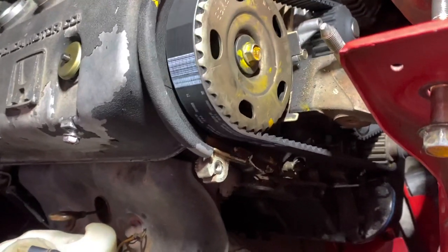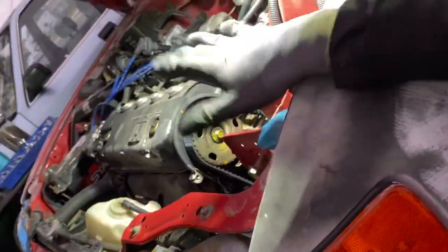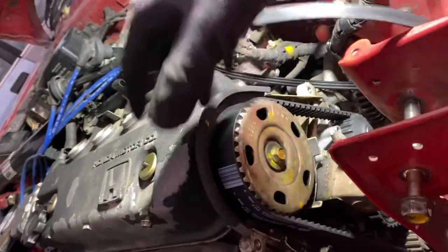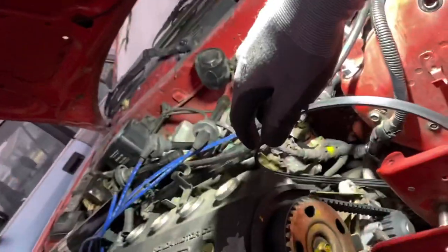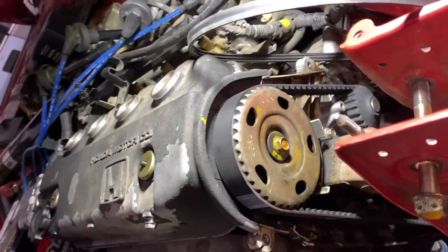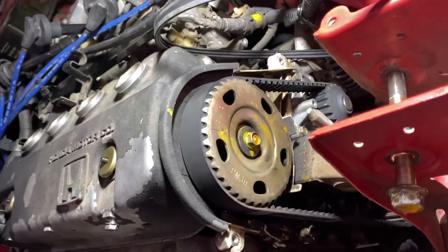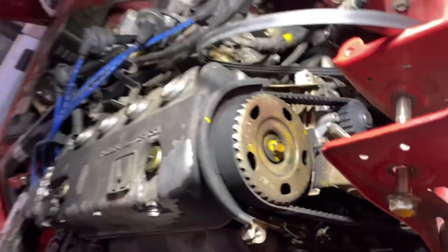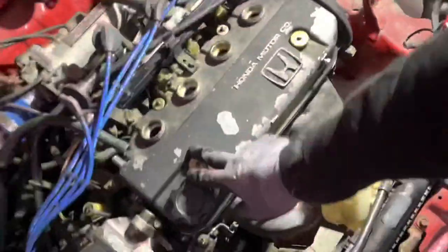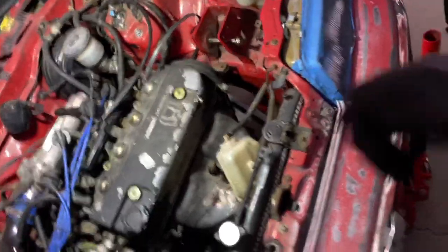She still feels good - I still feel compression. As long as you still feel compression you're good, and the engine's not hitting any metal on metal. It's very fluid in the way it moves, which means we're not getting any piston-to-valve slapping. You want to be really gentle with it when you crank it over the first time. I always recommend trying to do an entire crank by hand just to make sure your full rotational assembly is still spinning freely before you fire her up.